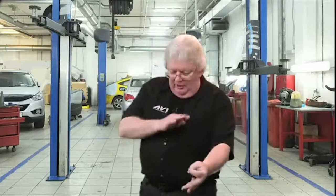That is a good symptom and tech tip: if your customer says they've got to take this thing out and actually hit the unlock button on their Prius or Camry — whereas before they could just leave it in their pocket or purse, walk up, and unlock it — that's a useful diagnostic sign. There is also a button that will deactivate the Smart Key system on some models; it says the word 'key' on it and it's under the dash, straight under the column.